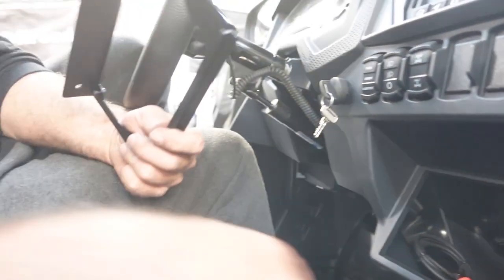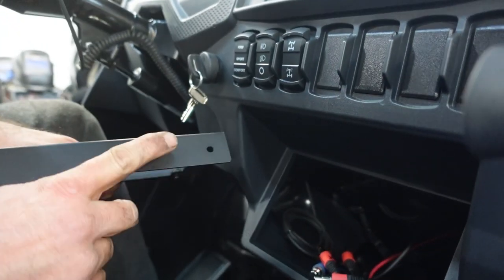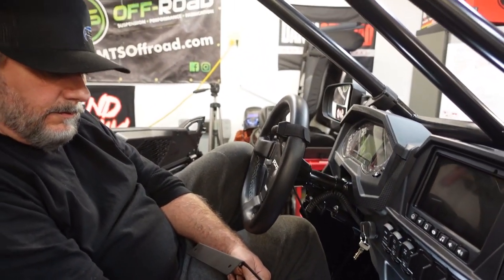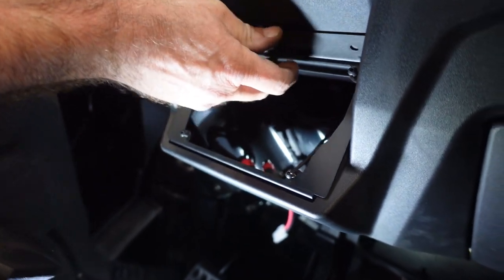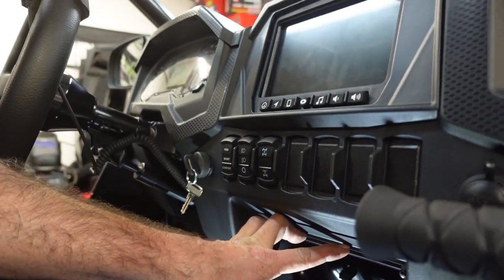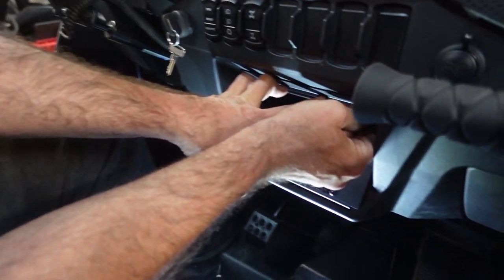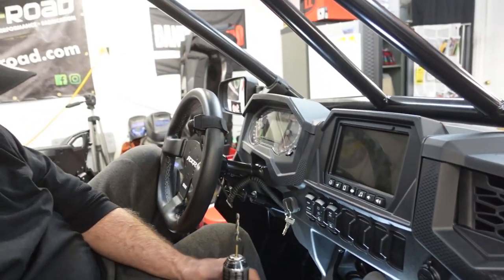I'm going to drop it down like this — get this little lip right here where it fits in the opening of the console box and holds the bottom in place. Then notice these two screws right here — we're going to drill up into the dash. It's not like the cutting before. I'm going to push it back in place, hold it, drill a hole, matching the hardware to the drill bit size, then drill the other hole.